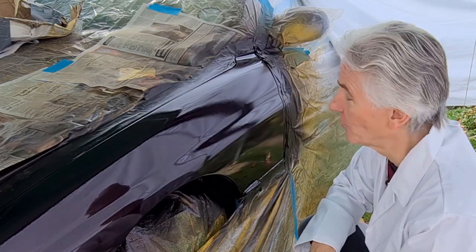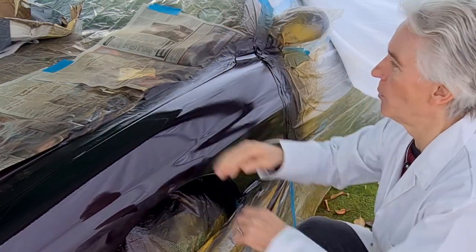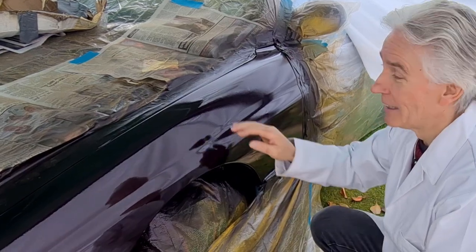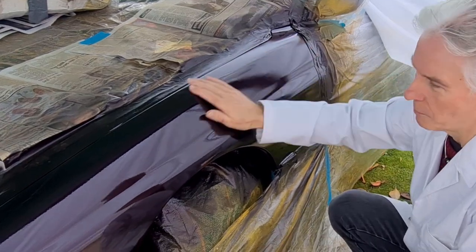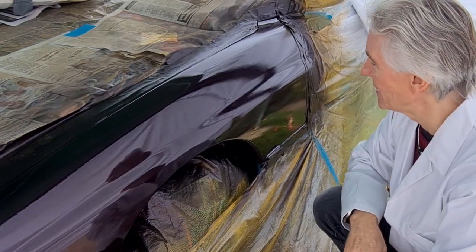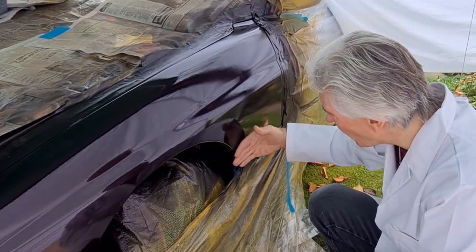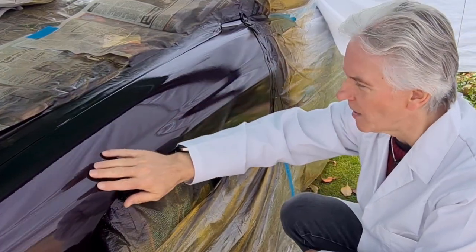And to compound the problems, overnight it got really windy and it just blew everything over. So all the paper here flopped over the wing, and everything was covered with leaves again. Hasn't done the clear coat any harm at all. All I used was a tacky cloth to get the bits of grit off of it, and it's very smooth, I'll give you that. That bit is fine. This bit's speckly. And there's a run there as well. I was putting it on too heavy and there's a slight run there.